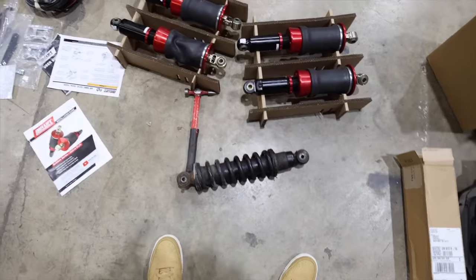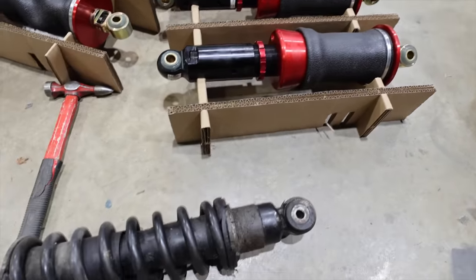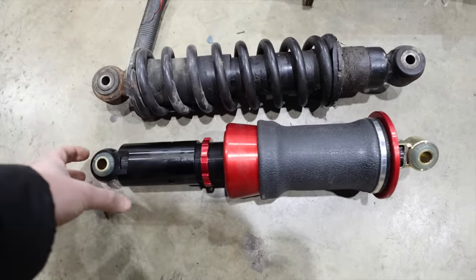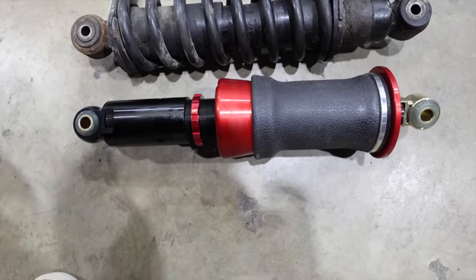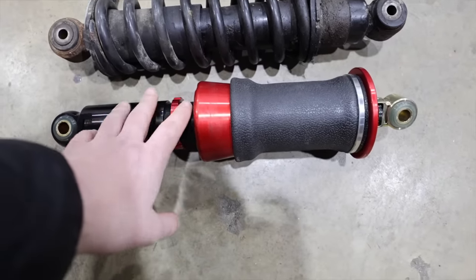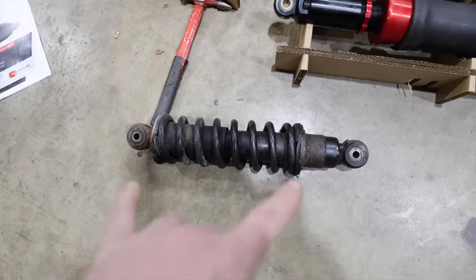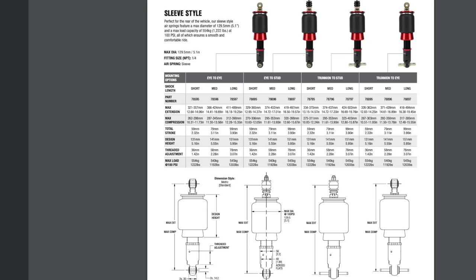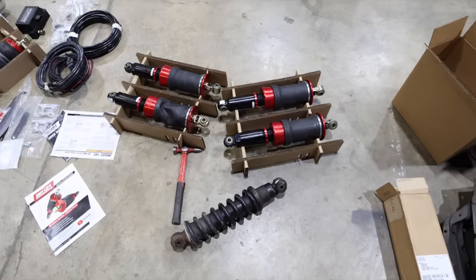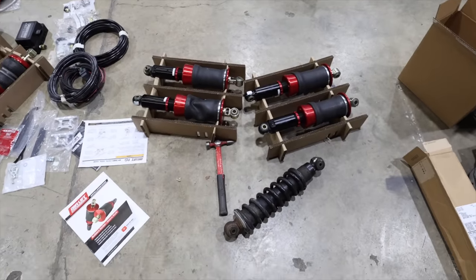They have different lengths as well, and you can screw these down to change lengths with a certain amount of adjustability. I went with max extension being the lowest setting on our length, so we can always go a little bit taller and use the air system to go lower. I pulled off one of my shocks, let it be completely expanded, measured eye to eye, and on their website there's a huge chart for long, medium, or short versions. Our application landed on long for all of them.